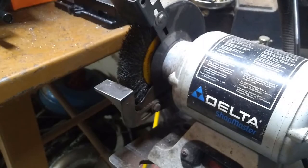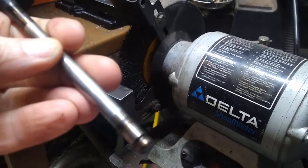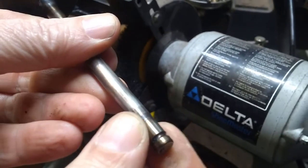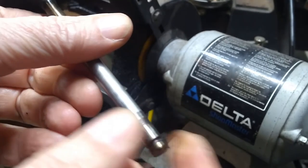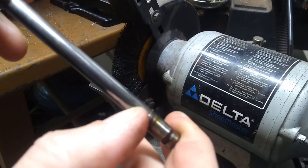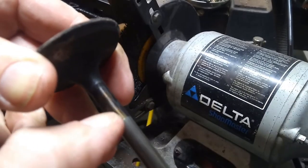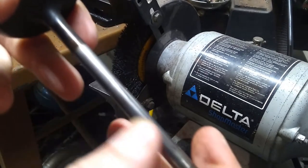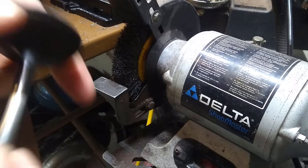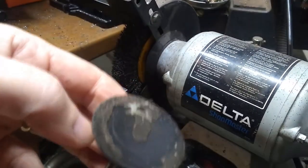We'll just clean some of these up — pretty simple. I'm going to hit the wire wheel. We've just got a little bit of varnish from where it is above the guide seal. You want to take a look at them and feel for any ridge here, and also down here where it rides in the valve guide itself. Then I'm going to clean up this with the wire wheel, all the way around and up on this side.